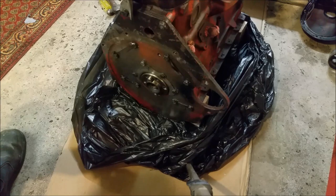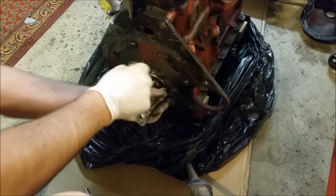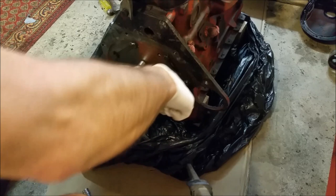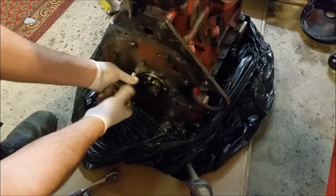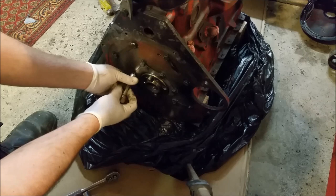I'm going to pop this rear main retaining ring — or horseshoe thing, whatever you call it — off. It's good that whoever had this engine out put these tabs back on. They're a bit manky and secondhand, but the fact is they've been put back on. I'm talking about these straps here. We don't need to plate any of this stuff — we're just going to put them back in. These are 5/16th fine threads, and they're just small threads.